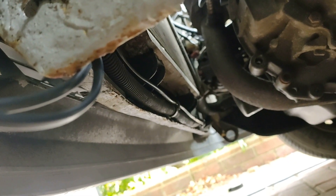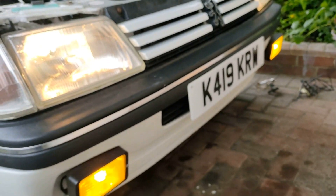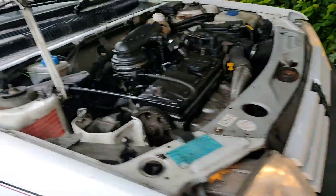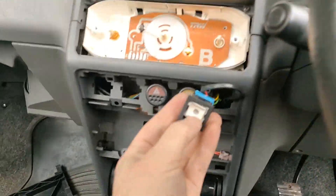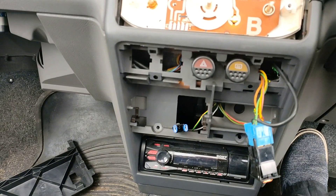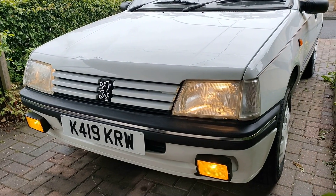All the way along with the piping to keep it out of the way. The sensible test now we've got everything wired up: pressing the switch. I have blown a bulb by wiring it wrong, but that is the switch on, so when we go around now we are going to see fog lights. Yellow — excellent, fog lights! Very pleased with that. And then around the back of course — a rear fog light, all connected. So we've got separate front and rear, just one switch to get it all on and off. I'm not planning on running them for fun — I will now have to get a new bulb for that. That is everything wired up and connected; I now have to put everything back together and tidy up a bit.